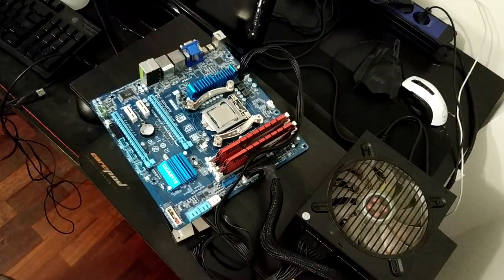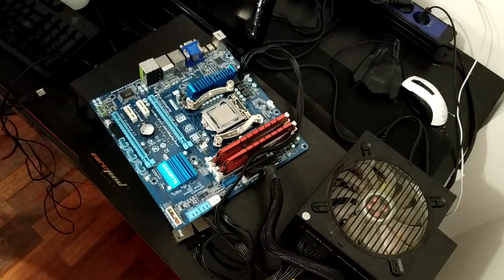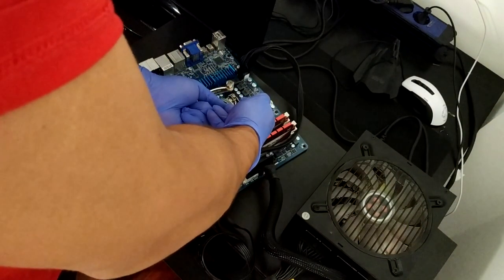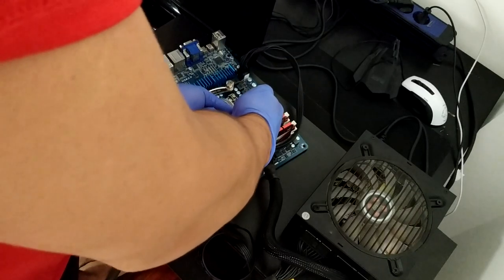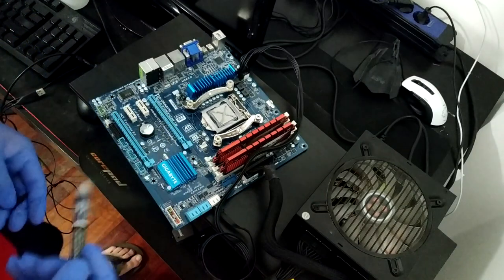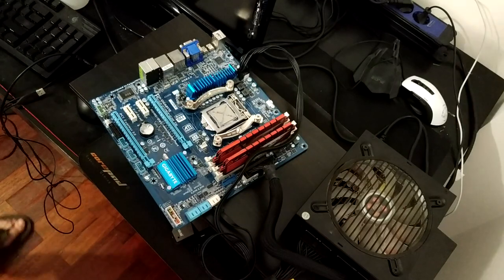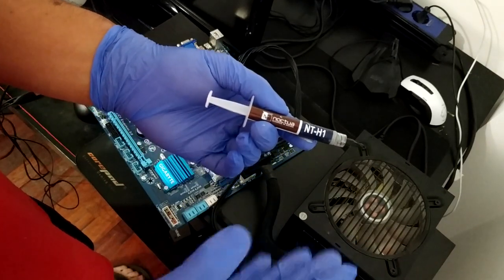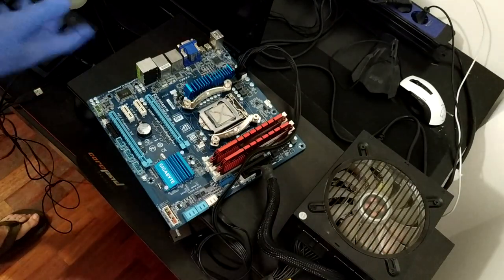You just need to get your thermal paste that's included with the cooler and put it on your CPU. I usually put it like an X. Everything is good as long as you don't have too little thermal paste, because it has been shown that too little thermal paste is worse than too much. Provided that your thermal paste is non-conductive, like the Noctua NT-H1 we're using — because if it is conductive, you don't want it splooshing all over your motherboard, as it could fry it.